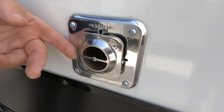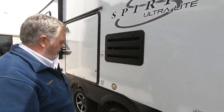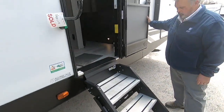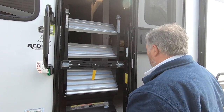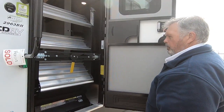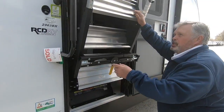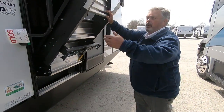This is the back of your furnace. It does get hot when you run your furnace, so don't set anything in front of this — nothing that will burn or leave a mark. Don't set a table up against it; leave that area clear. Your door has to be open all the way — simply lift your steps up and lock them into place. If your door isn't all the way open it's going to scratch and dent the door, so just make sure it's all the way open. You have adjustable legs here; if the ground below you is not perfectly even, you can adjust your legs.